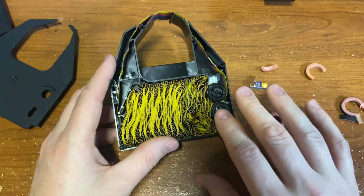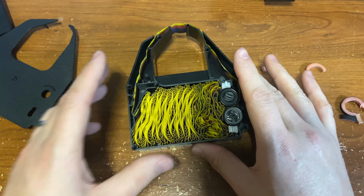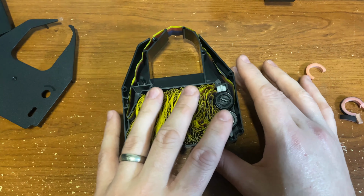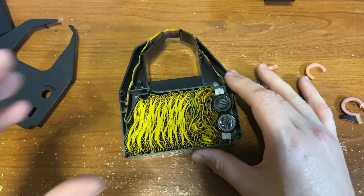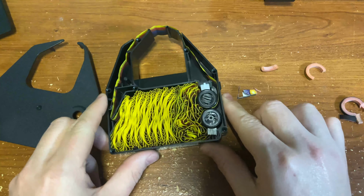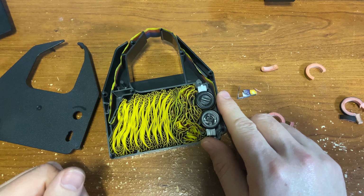So you see, this is really easy. Just get yourself some number 11 O-rings, throw it in here. If you have any of these printers available in your stock already, replace the O-rings, put them on now. If you buy new old stock color, replace it. So we're going to get this button back up after I put my plastics in off camera. We're going to go over to the ImageWriter and I'm going to show you how beautiful this thing can print.